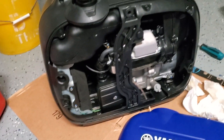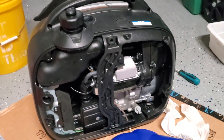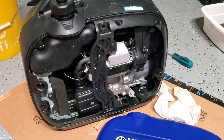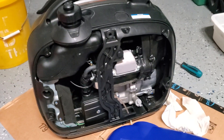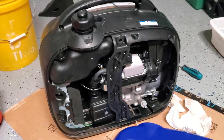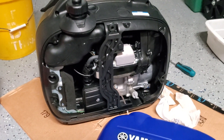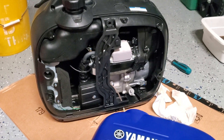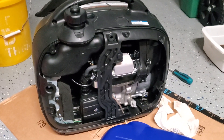What I did is I back-fed the house — I just stuck a double male plug into the socket. Be very careful: that double male will kill you if you're touching it when it's live. So everything's got to be off first, and also shut your panel off completely, your main off. Anyway, I hope that helps you guys. Appreciate any likes and subscribes. Oil changes, a real quick carburetor fix, and proper storage. Take care guys, appreciate it.